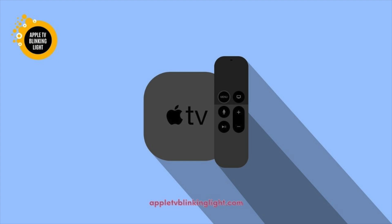Using the software, you can try resetting your Apple TV. A simple restart of the Apple TV can fix the problem. Hold the down arrow and menu buttons simultaneously for 5 to 10 seconds. When the Apple TV is rebooting, the white light should be flashing rapidly. If you're unable to restore the content, you can try to repair it by following these steps. If you can't find a solution, you can contact Apple Support for help.